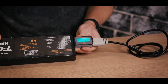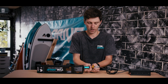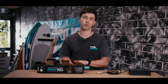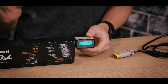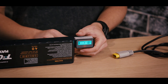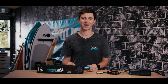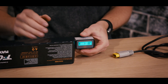We can see it's come up to about 23% after only a few moments. If I unplug it now, the charger will stop and the percentage will lower back down to the true value of the battery — it only takes a couple of seconds, but it will read five to ten percent higher than the true state of charge. So keep that in mind: if you're aiming for a certain charge state like 50% for storage, run the charge until it reads about 55%, then unplug it and it will settle back down.